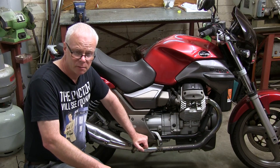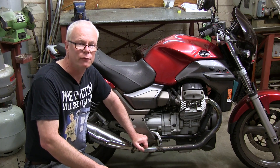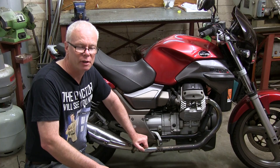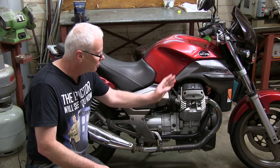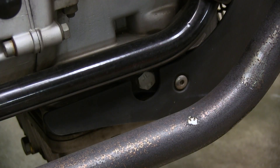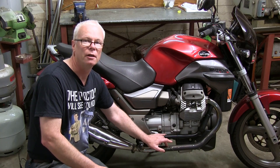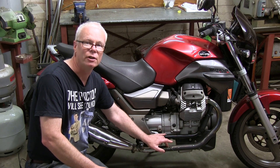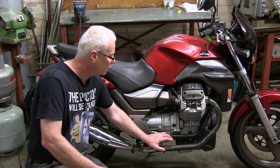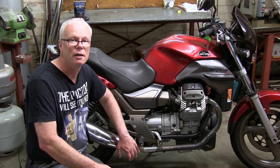Over the 15 years we've owned this motorcycle we haven't had much in the way of problems. The most obvious issue was cosmetic: the chrome plating on the exhaust system disappeared fairly quickly in the first couple of years. It's purely cosmetic and hasn't caused structural damage, but the chrome on most of these small blocks disappeared pretty quickly. The big blocks of this era used stainless headers, but on these they were clearly saving money with chromed mild steel, and the finish came off the header pipes and the underside of the mufflers.